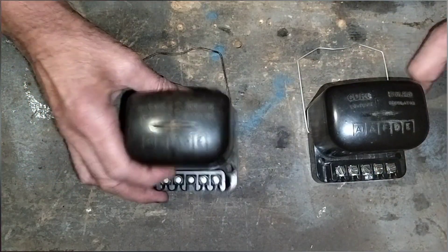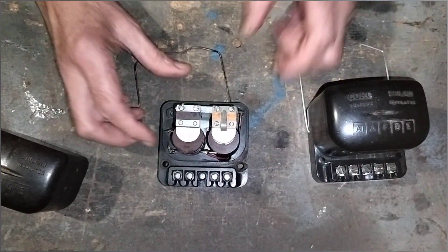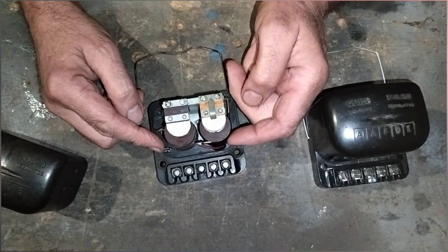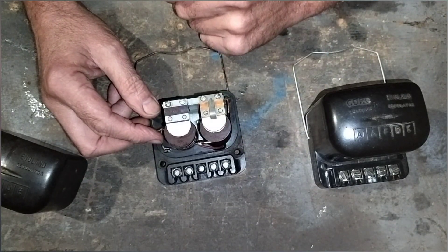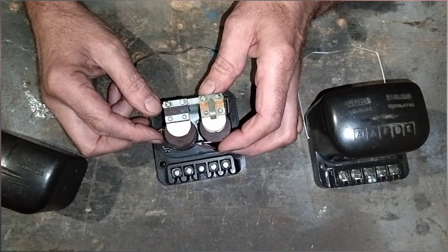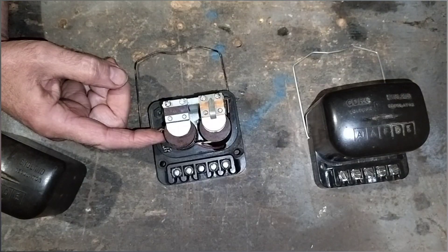These are the control boxes. This is the old 70-year-old control box from our Series 2. Inside you can see the copper windings — on one side we've got the regulator, and on the other the on/off switch copper winding. The on/off side just turns on and off when your battery is charged, switching the current back so it doesn't back-feed your coil. The other regulates your voltage through the car via two little electromagnetic switches on each coil.